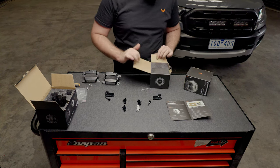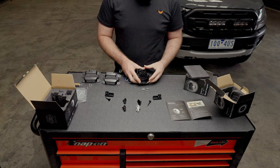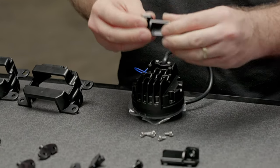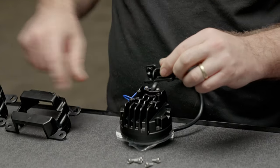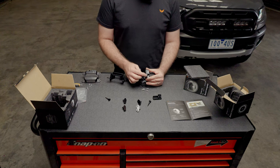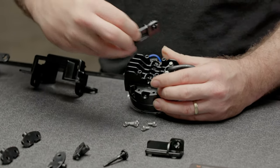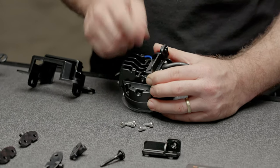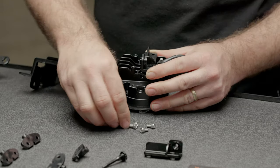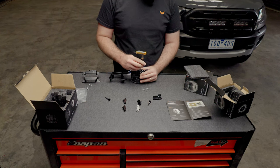Open up your boost driving light and keep the plastic on for now — you don't want to damage the lens. On the back, have the cord side closest to you. On this adjustment screw holder there is also a number that corresponds with the cage. On whichever driving light you have, this adjustment screw step needs to be closest to the center line of the driving light. You'll know you've put it the wrong way because it's touching the cord and it's stepped away from the center line. Start by screwing this down — get it started, don't cross-thread it.